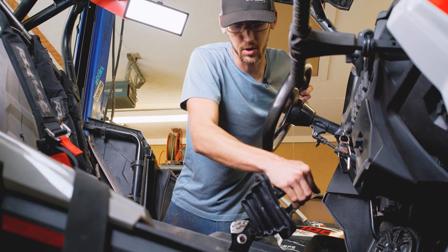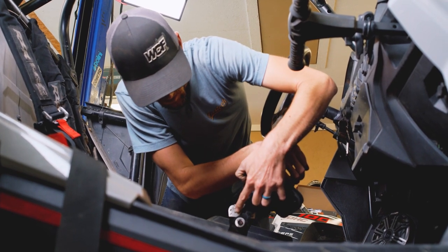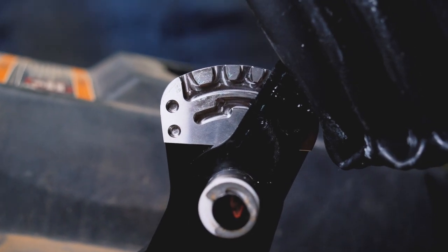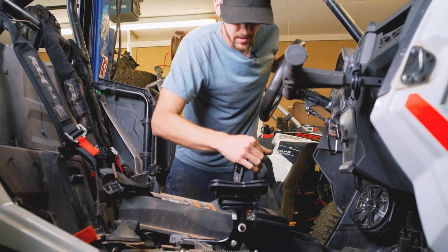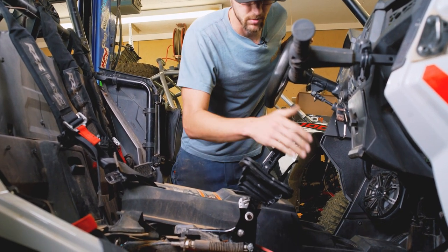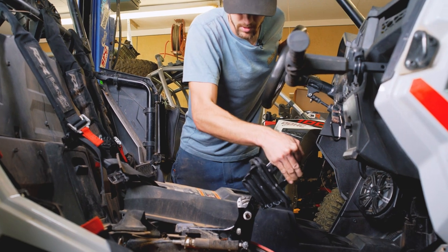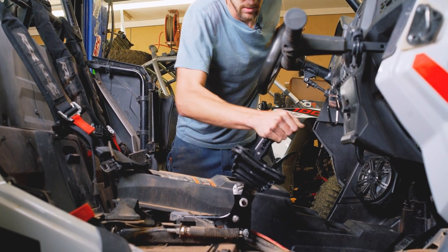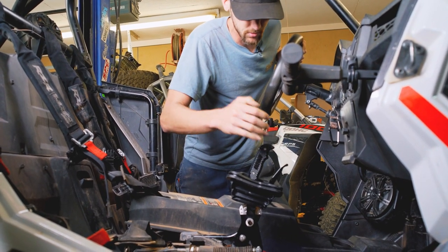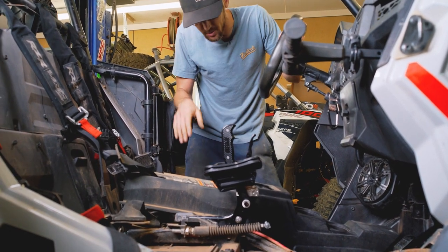You can also pull the lever again in park, and it drops the pin selection down to our lower non-gated section. And once you're in reverse, you can go straight to low, all the way to high, back to low, bump to reverse, and into park. So once you have let go of park, you can press one detent and you're locked in reverse. Then you can go to neutral, low, and high, all in the same shifter.